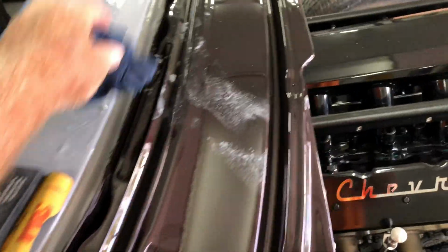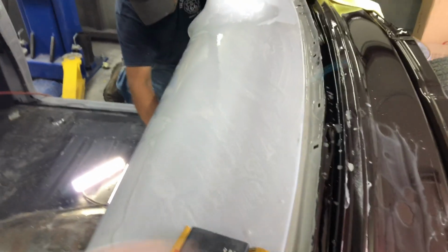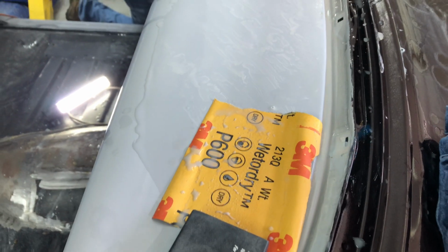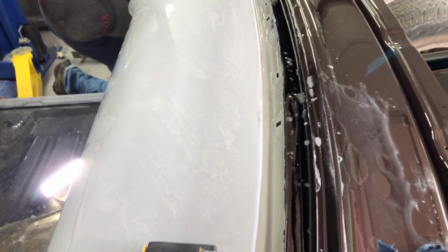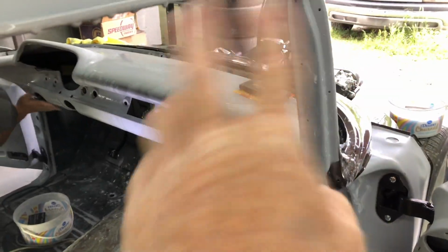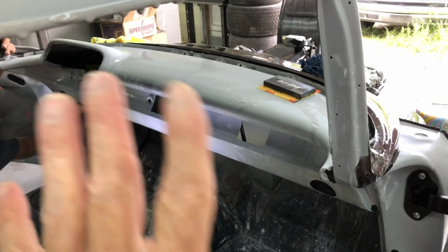All right, so the first sand I do with a 400, I just do it lightly, get it all cut fast and down, and then I finish off with 600. 600 wet and dry, and just finish it off with that, get it all nice and smooth. And then I'm going to do the face dash with Steve. That's what his job is. He's doing the underneath, and we're sharing the underneath of that. Same, 400 first, just to cut it down, 600 to smooth it off.